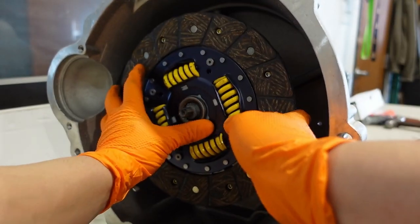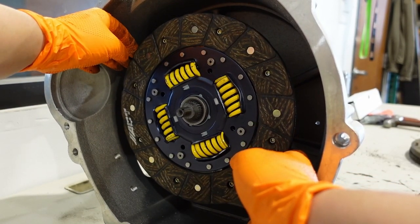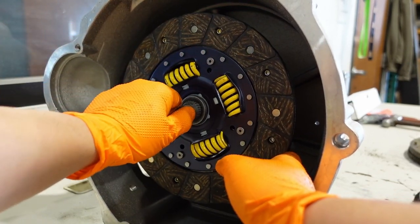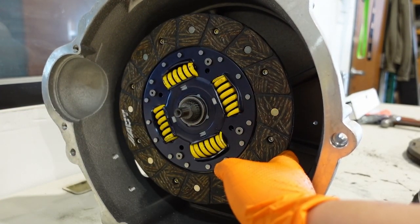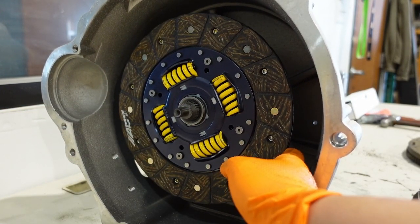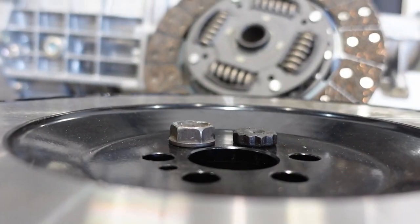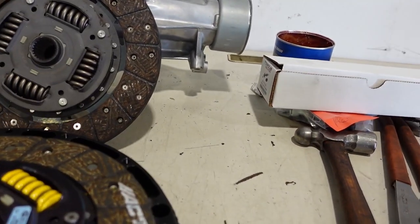With the Subaru disc, I have virtually zero deflection between the input shaft and the hub splines. The only deflection is from the input shaft bearing, which is normal since we don't have a pilot bearing supporting the front of it. I can't take full credit for this test — Derrick at Dotson Works is the one who came up with it and suggested I try it. After doing so, we both agree you need to have the Subaru disc installed.